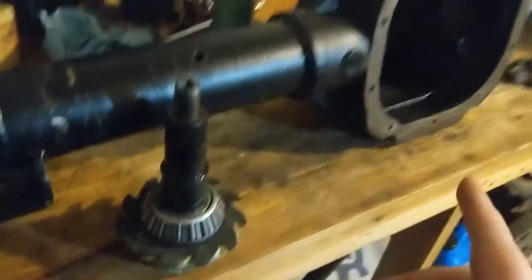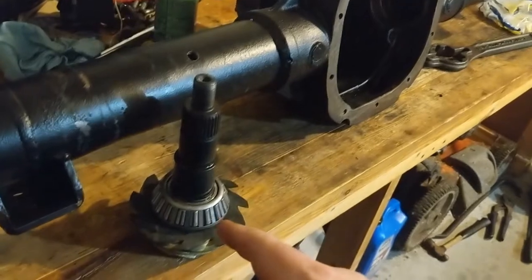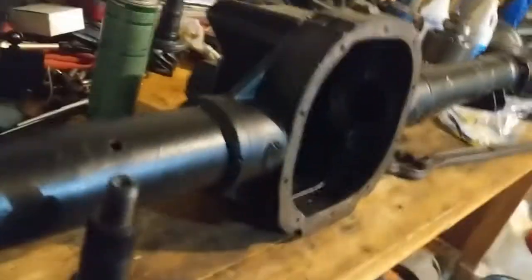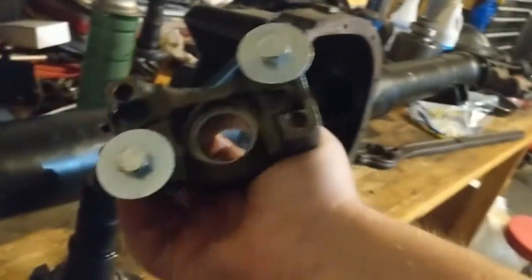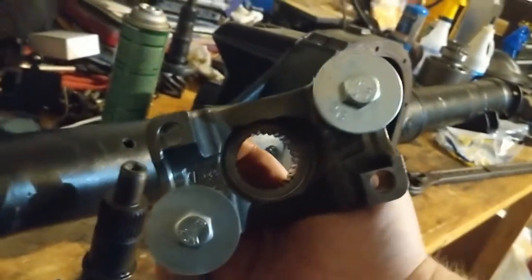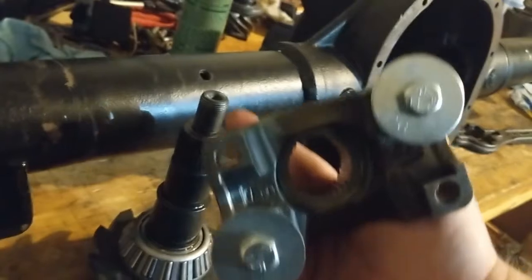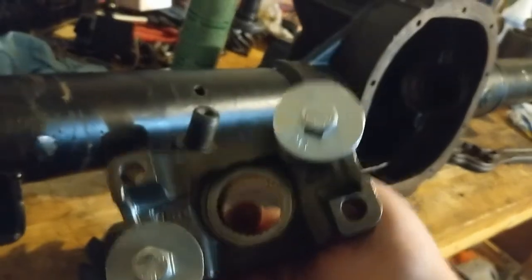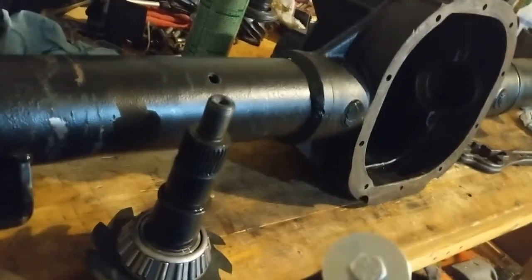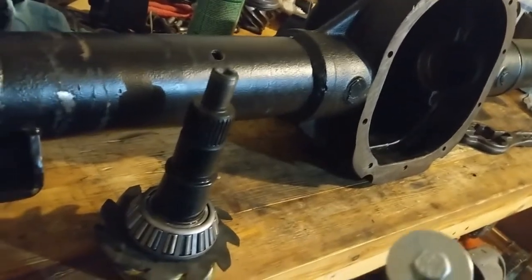So Dad's over at the garage right now, his garage, grabbing the big 3/4 inch bar. Sorry, I was kind of jank filming here because I'm stuck on the charger. But I got these bolts that we're gonna use with that tool there to hold the pinion flange still. He's gonna hold on to that while I tighten it, where I gotta crush the crush sleeve, get the pinion flange on. I gotta put black RTV inside these teeth here to make sure it's all sealed up. But yeah, going in for the final assembly now. It's pretty exciting, but we're gonna get to it.